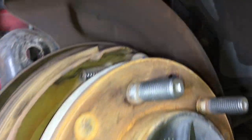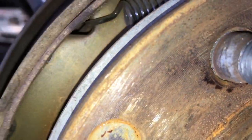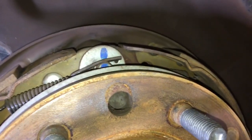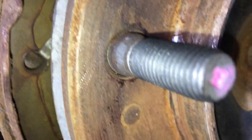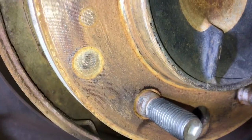We're removing the rotor just to check the thickness of the handbrake shoes as per the customer's request - we don't do that every service. It's not a safety concern if they go metal to metal - your handbrake will still work, just get screechy. These aren't your main brakes, just the handbrake. If they wear through you'll hear squeaking, it'll get pulled apart and you get new shoes, probably new rotors. Not a big deal. If you can't get the rotor off, through this hole you access the adjuster.